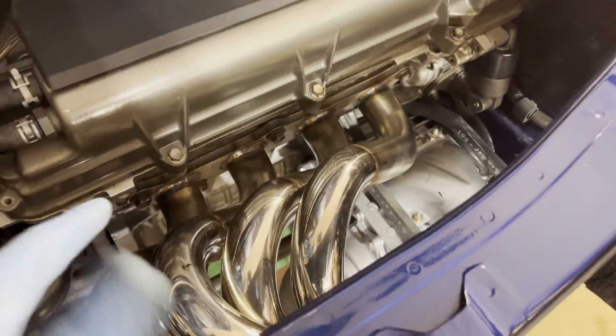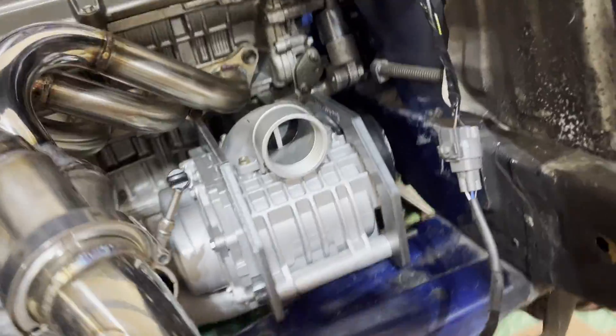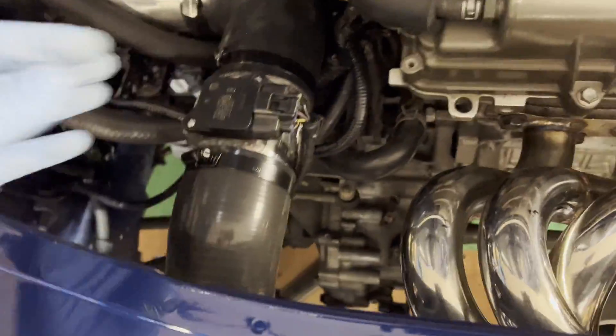Got the fuel pump in. I also went ahead and added the exhaust manifold gasket so that should seal up now and it shouldn't sound like a tractor anymore - I had huge exhaust leaks if you saw that video. I had to extend my O2 sensor harness and that is now plugged in. It is time to spin the supercharger. I got all the intercooler piping at least mocked back up, and obviously it's just open down here so the supercharger is not feeding the engine - it'll basically just be running NA but with supercharger noises. I'll set up the camera and you guys are gonna see the supercharger spin before I do because I'll be in the car.